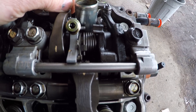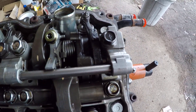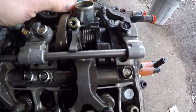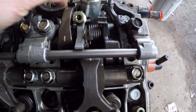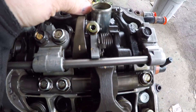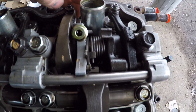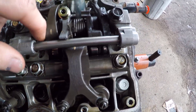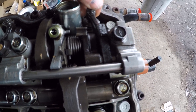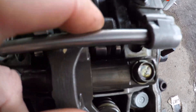It's not that we don't like fuel economy — saving fuel is a great thing — but what we want to do here is increase the longevity of our Subaru engine, in the same manner as the pre-AVLS Subaru EJs, which had solid lifters and a consistent, full amount of lift or depression of the valve spring for the intake cams on both lobes.